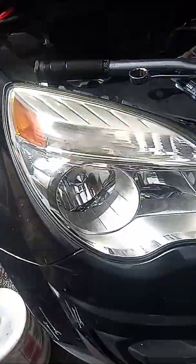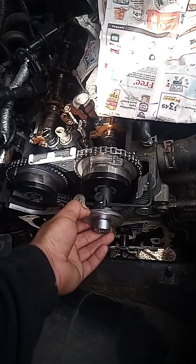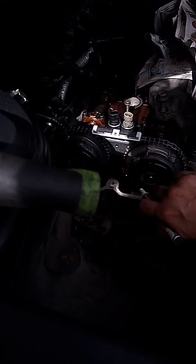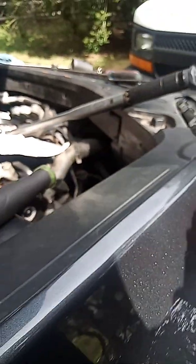Set to zero degrees, place it right here. As a quick tip before torquing: I'm going to mark this — put a mark right here and another mark right here, so I put two marks. Now that we have the marks, we need to torque this thing 100 degrees, so you need to get a wrench for that.